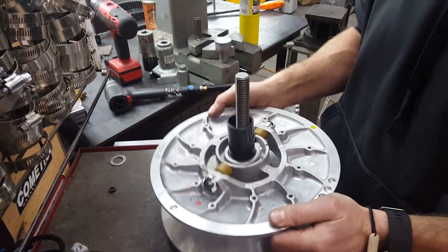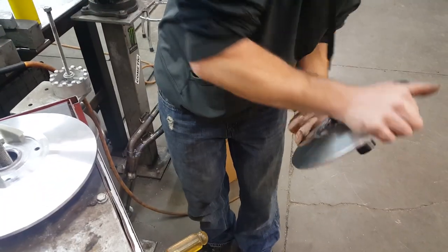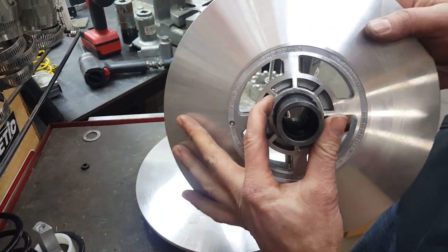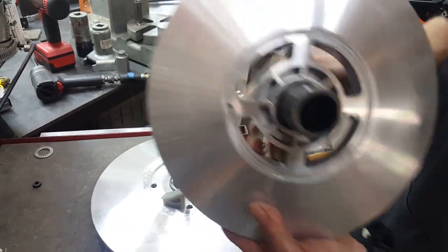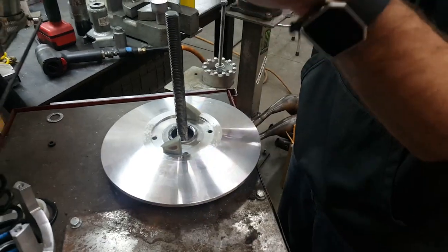That's where we're going to drill it. You don't have to drill the whole way through — you just have to drill far enough for the spring tab to stick in it. You can see on this side it lines up with this bridge. Don't drill the whole way through that bridge, just drill in far enough. You can kind of see where it came through, and your hole should line right up with that. Now I'll put this back in.